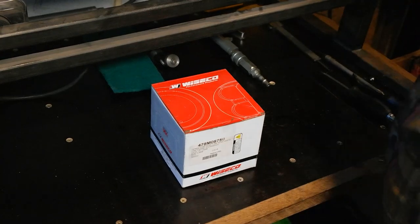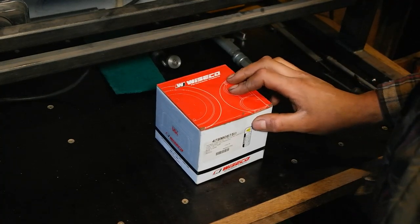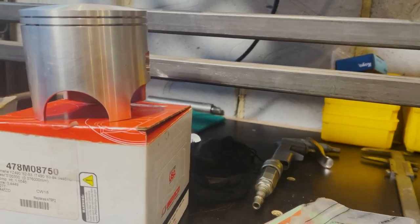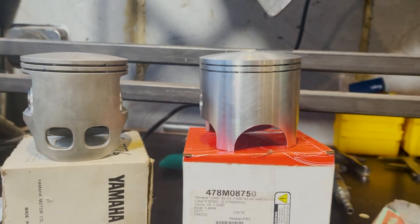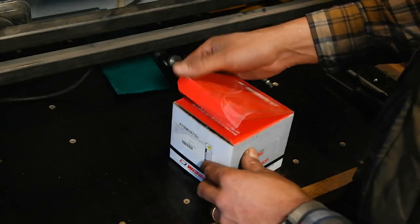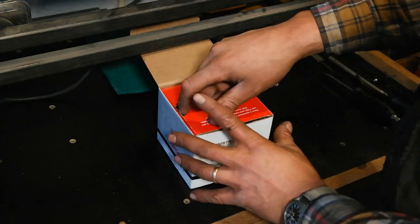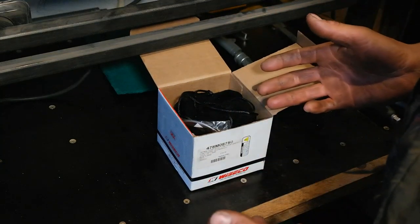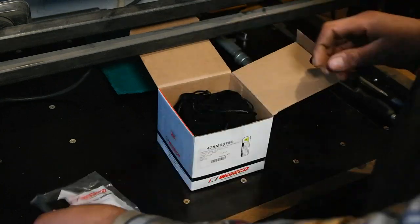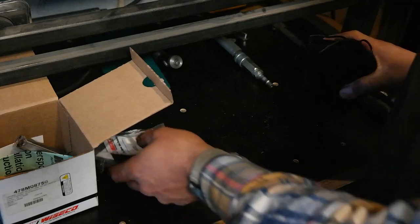Here's the piston I'll be using - it's a 0.5mm over Wiseco. Originally I had actually ordered an original piston because I kind of like to stick to original pistons with air-cooled bikes. I ordered a 0.25mm over originally and the cylinder didn't clean up at that, which is why I had to go for the 0.5mm over and I couldn't find an original one. A lot of guys run these and have no issues - I guess it's just me and paranoia. Air-cooled runs hotter on one side and so on - with water-cooled bikes, maybe there's a more even heat distribution. But guys run Wisecos every day with absolutely no issues and run some crazy power through these with great results. I guess it's just me and an old myth I must have heard somewhere.